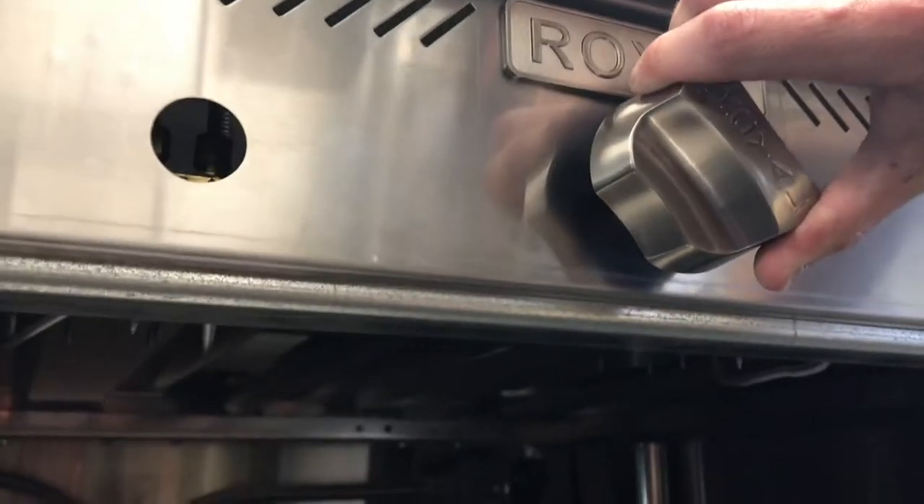Your griddle pilot lights are going to be under here. Follow these little tubes — they'll lead you right to your pilot lights. Just stick your lighter up there and they are lit. You have three of them on this machine. Make sure all three of them are lit before you turn your burners on. Once your pilot lights are lit, come up here and turn this knob to the on position and those will light your burners.